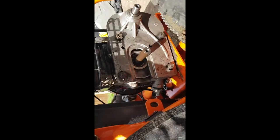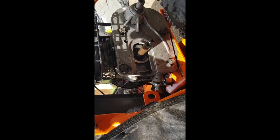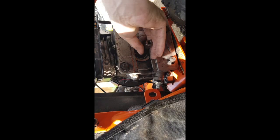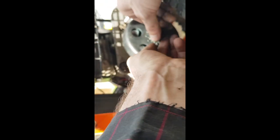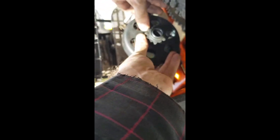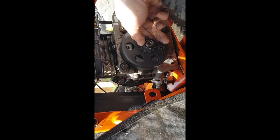So we're doing everything pretty much in reverse. Remember, don't get too eager and just stick it on — you need to use your thrust bearing, it goes on first. Then it's not finding the keyway in this one for some reason... I didn't think it was gonna fit. Excellent — right, now we need to get the other cog so we can get the chains on.